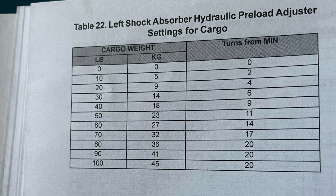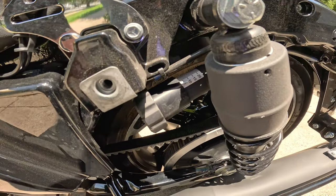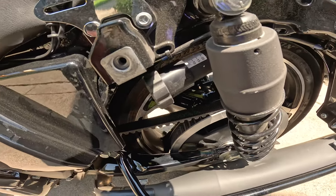The next time I take a trip, I'm going to be putting another 40 pounds of gear on the bike — that's when you go to page 52. Look at the chart there; it tells you what number to pick on your fine-tune adjustment right here. You can see the numbers one through 20. You rotate it to go in, rotate it left to pull it out. That lets you increase the preload to adjust your suspension for the additional weight on the bike. I suggest you try setting this up before making your judgment call on whether you need new suspension.